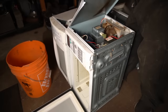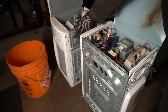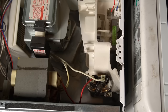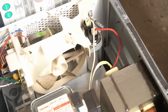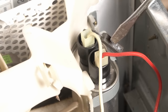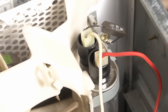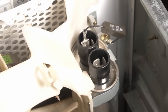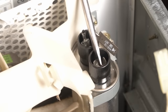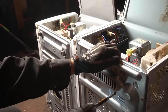I'll crack these open just like the previous one — and yes, both of them have the other design we're hoping to see. It's these big chunky transformers — those are what we want. However, they come with another potential hazard: this large capacitor right beside them. If this capacitor was charged up it would be a serious shock risk. That's why they have discharge resistors built right into them, but just in case, we can bridge both sides together with an insulated screwdriver to short them out and release any stored electricity.